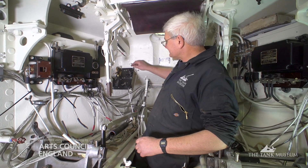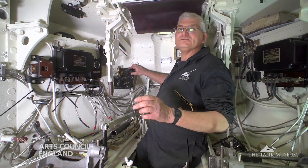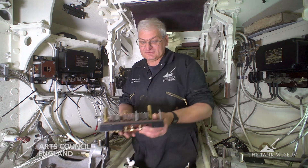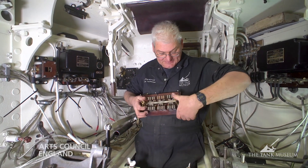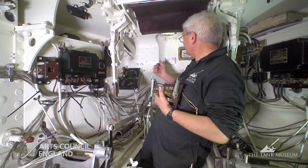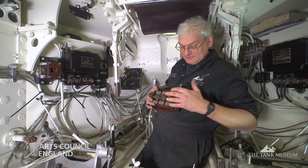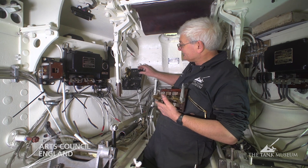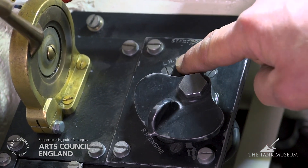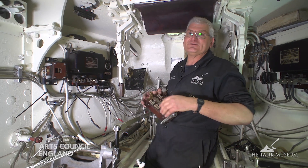That's the starting and lighting panel. The vehicle has a slightly peculiar electrical system in that the engines start using 24 volts, but every other system runs on 12 volts. So a series parallel switch is built in. You've got two 12 volt batteries, each consisting of two 6 volt cells in series. To start the vehicle, the series parallel switch series up the two 12 volt batteries to make a 24 volt system. You flick this switch over — there's a little label which tells the driver to remember to turn it back to normal position before moving off. Starting procedure: put that up, it's now 24 volts. You can only start one engine at a time — there's a spring-loaded switch on the starter panel, a button for the right-hand engine, flick that one over, then start the left. When your engines are up and running, put that switch back down into its normal position, and the charging systems will be activated and the two 12 volt batteries will be charged while driving.